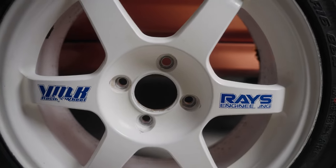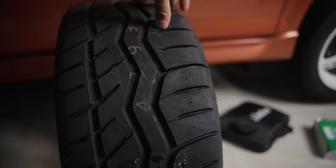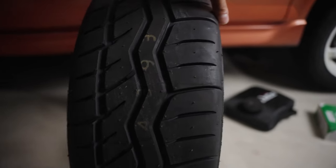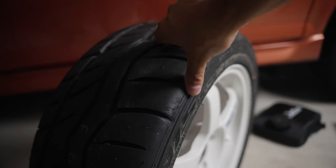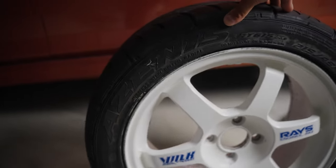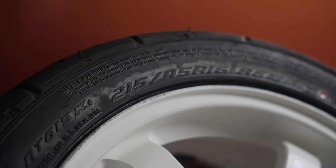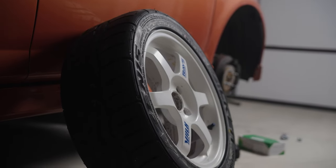It is the next day. I had to drop off the wheels to get the tires mounted on them, and now they're here. I never told you guys which tires I'm getting — I got some sticky boys for daily driving. I got these because they're still pretty cheap, cheaper than the RT660s. It doesn't rain too much in Austin and I'm obviously not going to be dealing with snow, so I thought I'd get some sticky tires. They are 215-45, which is not a common spec in 16s, but I think they look best on a 7-inch wheel.